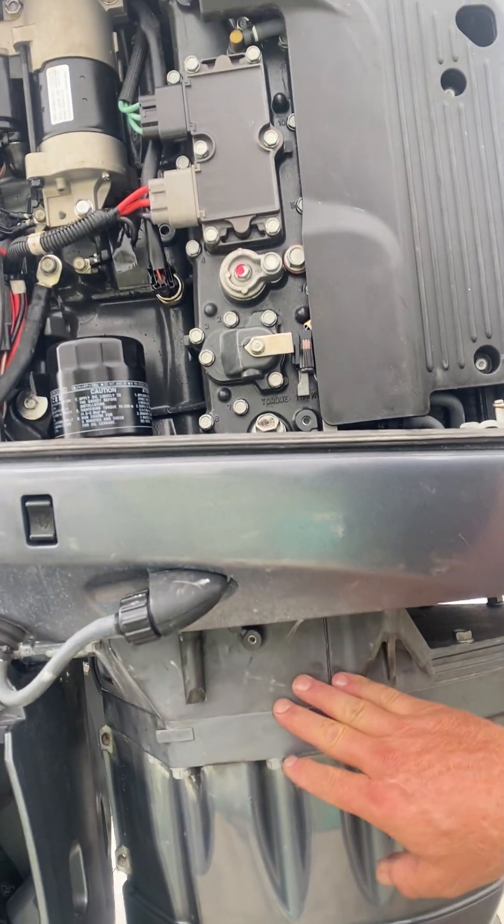I've already run it — it runs fine, no leaks. One thing I did: I filled it with cheap 10W-30 oil, ran it for 15 minutes, drained it all back out, changed the oil filter, then put in good oil. This problem seems pretty specific to the Yamaha 150. I haven't pulled the other cowling but I don't see any hazing on the other motor. Part of the problem is likely a cheap casting — probably from China — that can't hold the temperature it's supposed to. I've bought a lot of castings and I know Chinese castings can be junk.